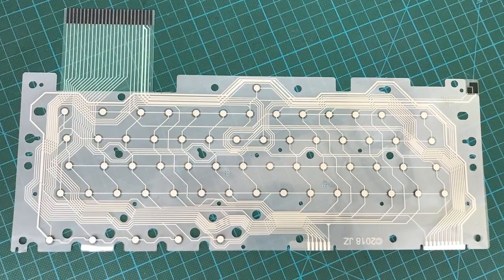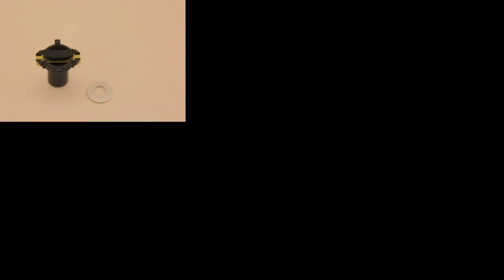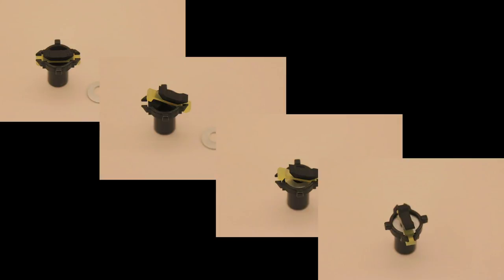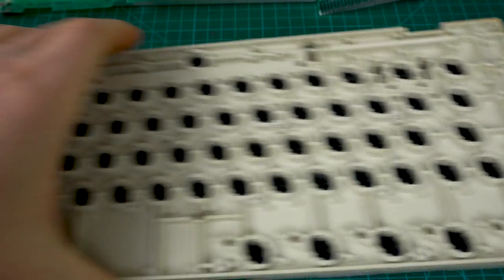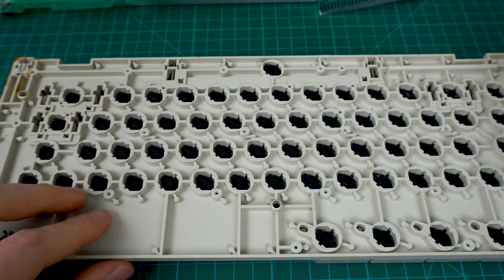I thought I was going to have to go back and buy a more expensive keyboard membrane, but it turns out there's a trick we can use to make the double layer keyboard membrane work with the spring keyboards. And that's to use M3 washers inside each of the key plungers. Apparently that makes them just long enough to make contact correctly and it works. So might as well try it. And here are the washers to the rescue. We have to put those in each of those keys.